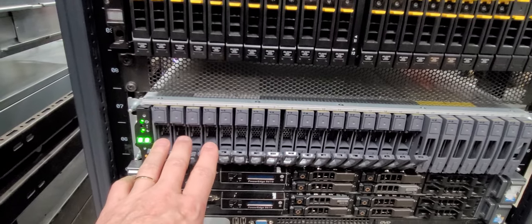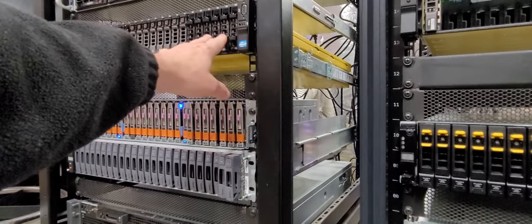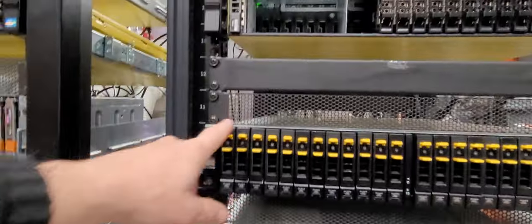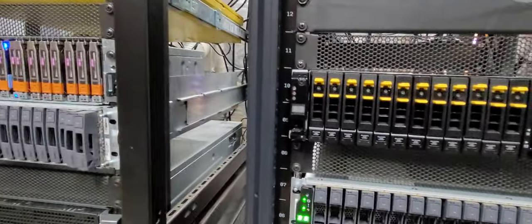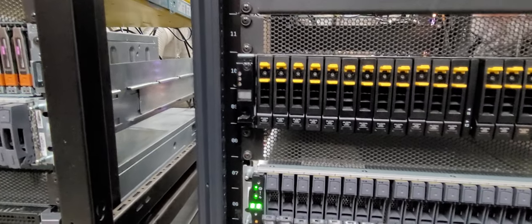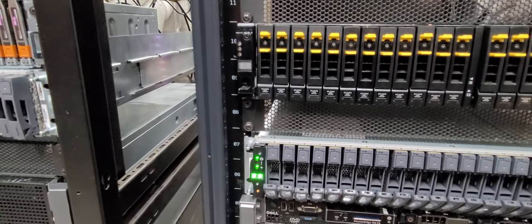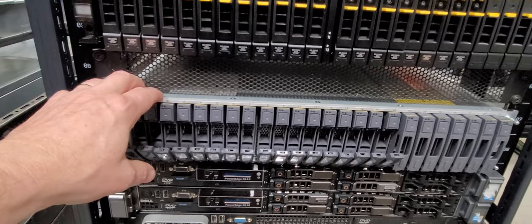That's good. Now, I know I can run this array and my server, and I can run the head server and its capacity down here side by side without any power impacts of any kind. That's because I've got 20 amps, 20 amps, 20 amps, 20 amps, a total of 80 amps providing the power feed. Now, that's not great. That's about a third of a house's power, so I have to be careful how much consumption I run through my circuits.